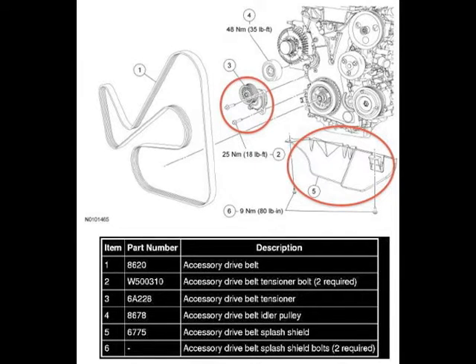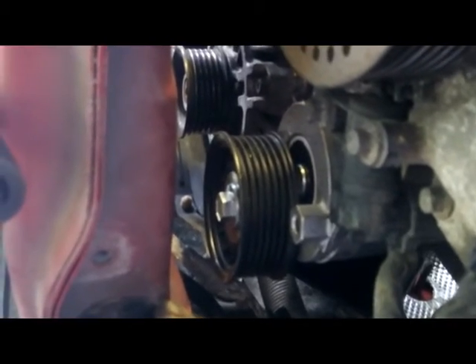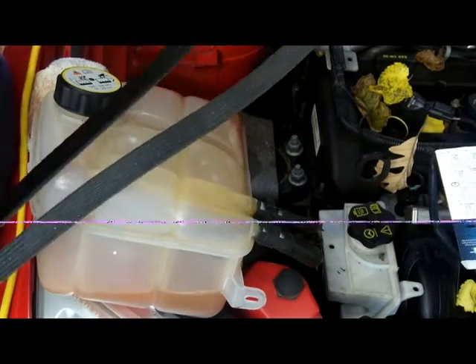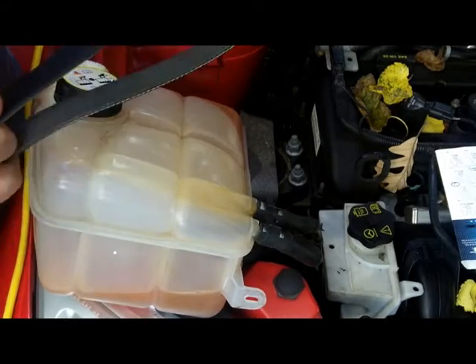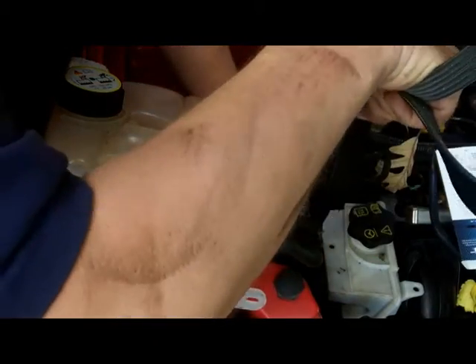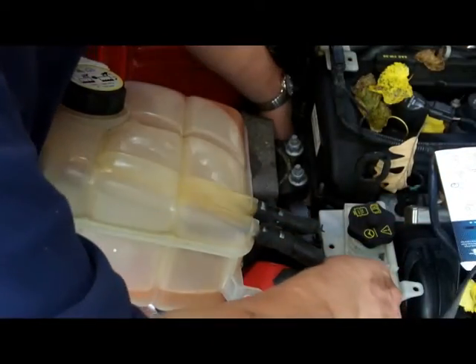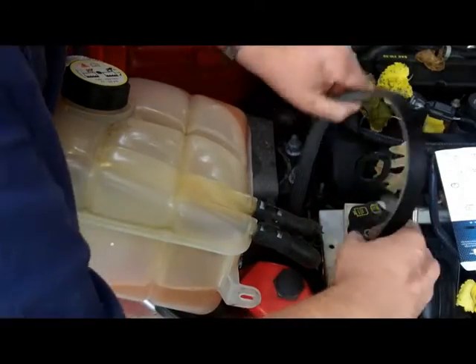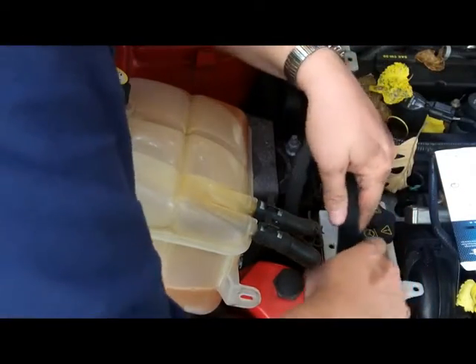The moment of truth — time to install that serpentine belt. Take a good look at your schematic, then go underneath and look at the wheels, make sure you know where you're going to be putting your belt — kind of envision it, maybe make yourself a cheat sheet. Once you're satisfied you can go up top, grab your belt, and slip it down in there. I recommend warming up the belt first — set it out in the sun while you're working on the vehicle so when it's time to slip the belt in it's easy to work with. This one had been sitting out in the cold and it was kind of tough to work with.